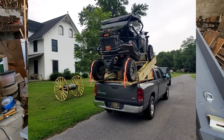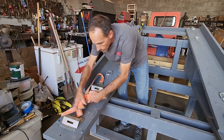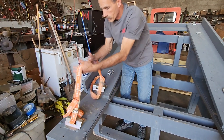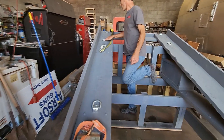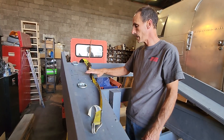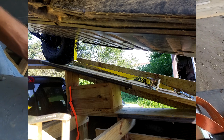As the unit is pulled up it goes over this cleat and the tire sits here where you can see the imprint. This is a wheel strap that clips in here, goes around the wheel, then this piece clips in and gets tightened down. We have D-rings in here specifically for the wheel straps. We were able to reverse the strap and make it shorter — we were originally running the strap from here over the tire and then running it down using the ratchet strap on the end.